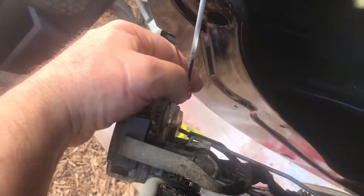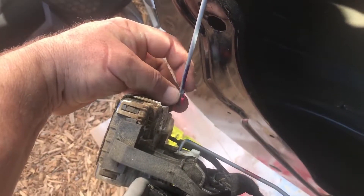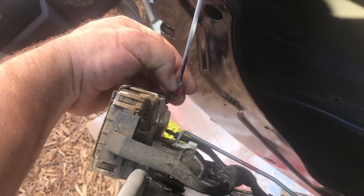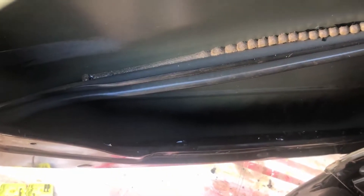These locking cables on the locking mechanism are easy to disconnect — just push this little clip back like so and disassemble it. There it is: push the clip back and it comes right apart, and you've got the whole piece free. Now go ahead and vacuum and clean up all that glass at the bottom of the door.